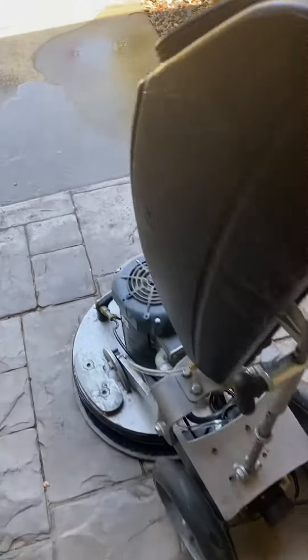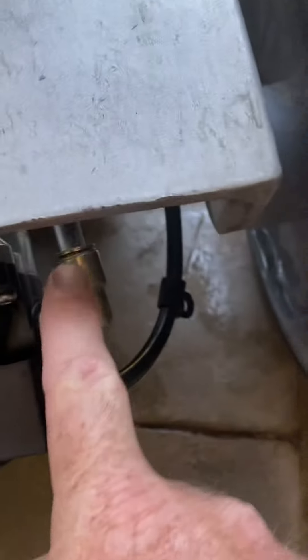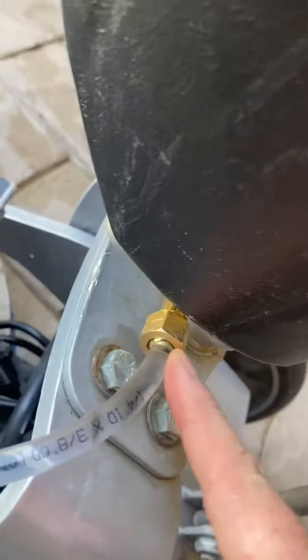It's working. The motor took a crap and I had to put a new 3/8 outer diameter hose from the tank. This was a push-to-fit, but stainless, and the old one fell apart when I tried to take it apart. So I had to use one of these crush fittings, which I can never get on straight, ever. You can see it's crooked, but it's not leaking, so I know it's doing its job.